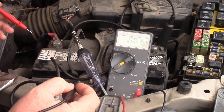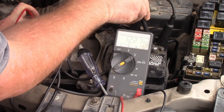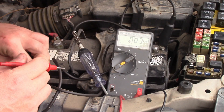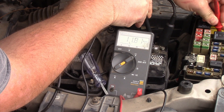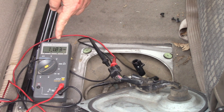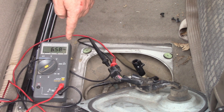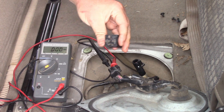Let's check voltages quickly to account for the voltage drop we're seeing. We're at 12.21 volts sitting here, and everywhere along the line — 12.2, 12.2, 12.2. But with the car in the on position, even at the battery we get 11.8, and at the relay 11.8 as well. On key-on it jumped to 11.74 then falls down to 6.6 volts. When you crank it, the battery is under load so it's only getting six or seven volts.